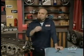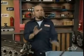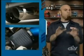On this show, we're always talking about how to get more air and fuel into the cylinder for more power. And that usually comes in the form of a cold air intake or a free-flowing exhaust. If you already have these on your car and you want more power, join the club. No, really, it can happen, but you have to talk to your valves. Now, your valves aren't going to listen to you, but they will listen to the camshaft. The camshaft's job is to determine how long and wide the valves stay open.